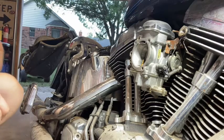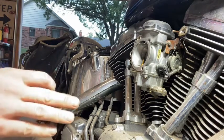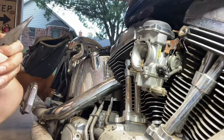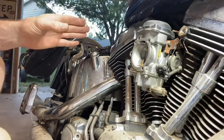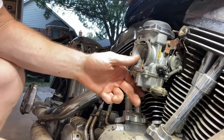Let's see what happens ladies and gentlemen. Awesome! Come on baby! She started! I'm gonna tune her up a little bit - that was a win. The petcock worked and we got her to run, but only on choke. So next I want to go ahead and pull this carburetor off and see if we can't clean her up because I'm sure there are some issues in here.